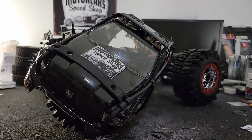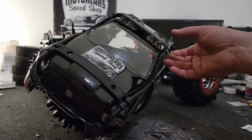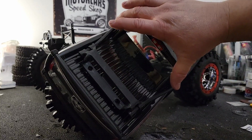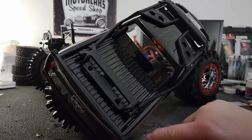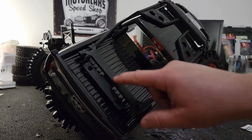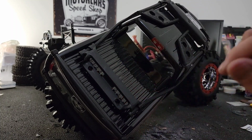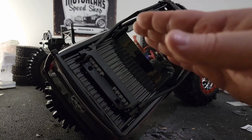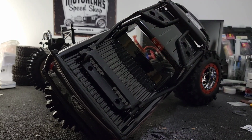I actually repurposed almost every piece of this particular machine, every little part and piece that I could from that cage, so there's not a whole lot left behind. When it came to the rear part, these should have gone outwards along the outer part of the body. This is actually the same section, even though it was probably moved forward quite a bit. The mounts on this bodywork are in the factory location. You can look back here at these mounts, which I melted down and flipped to move them forward in the chassis, because I had to make it fit a lot further forward once we had the front put together. It didn't fit. It was a mistake on my part, but it ended up turning out pretty good in the end, with some of the more work that we did to it.